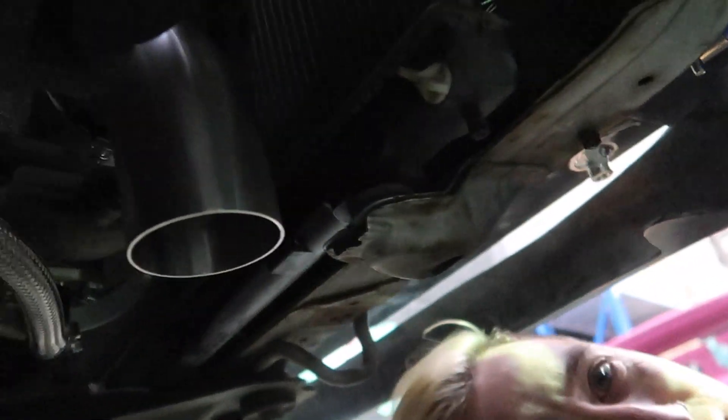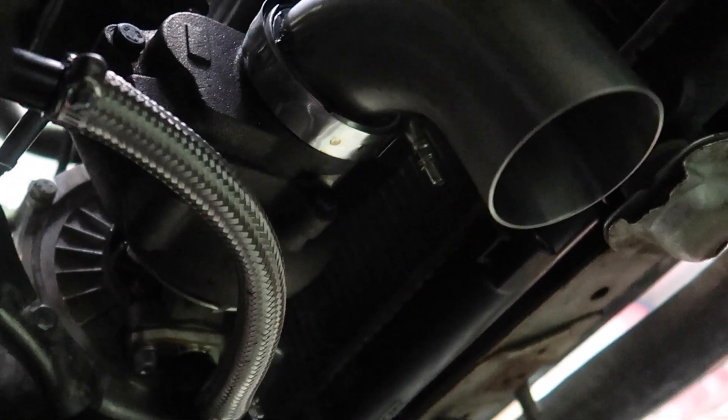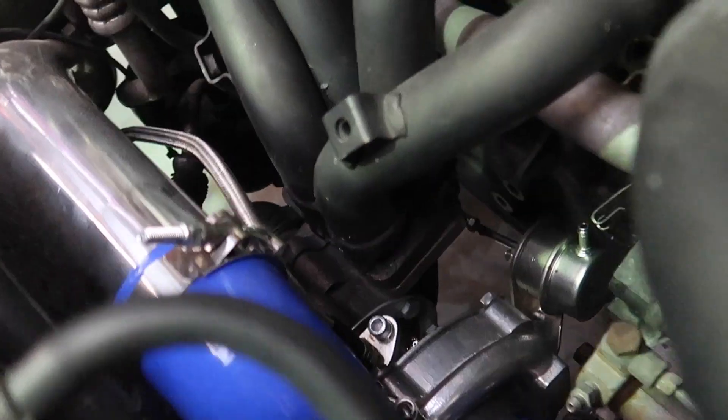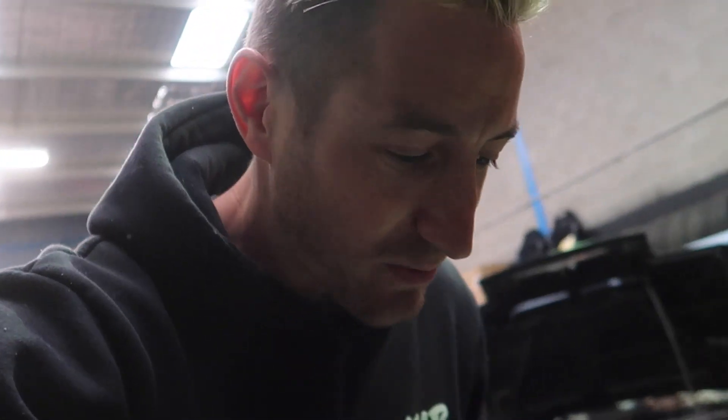The first part of the exhaust is tacked on - I don't know why I'm so excited about this, but it's a pretty monumental moment. Look at that - stoked! Also our wastegate is now on, hell yeah! So we can get rid of this line with a bolt in it that was blocking off our line, and go ahead and actually chuck a line from the wastegate to that nipple. We now have boost control, which is fantastic. I always put little jobs like that off because they're so tedious, but really glad we got that done today.